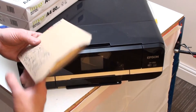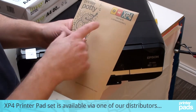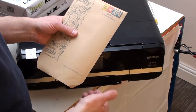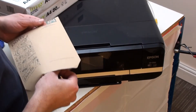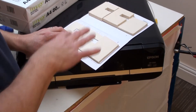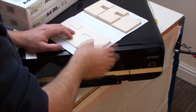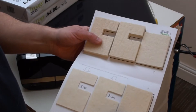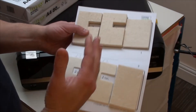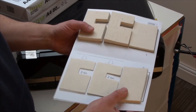The other thing you're going to need is a set of replacement pads. We have a set we sell called the XP4 print pad set from Print Potty. They are compatible with part number 1607470 — that's for XP900, 950, and 960. In your pack comes a carrier sheet which holds all of the pads required for your pad holder. It's a nice low-profile package so it will go through your letterbox or mailbox. Note that because pad thickness can vary, we sometimes include optional pads to fill any gaps. If they're not there, chances are they were never needed, but let us know if you find they were.